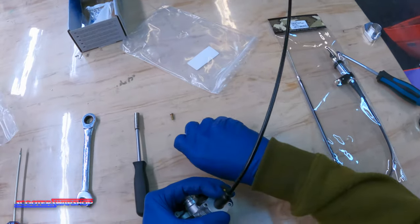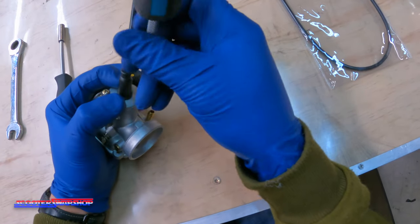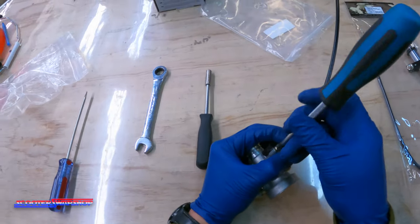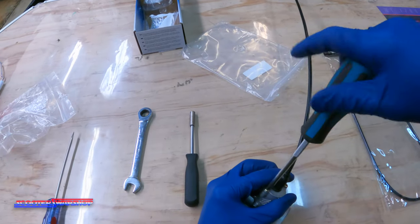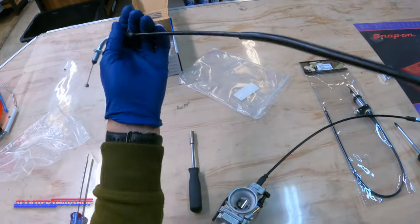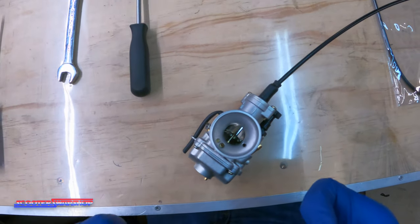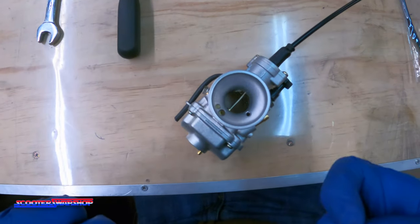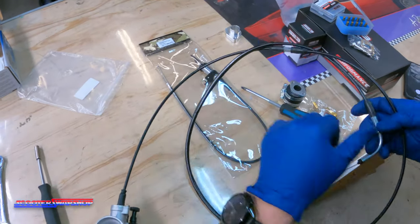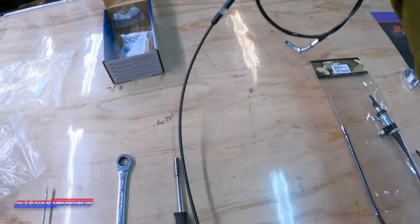Push this down. Now you can hold it with one hand, drop your two screws into position, screw them in. This carburetor install may seem a little daunting, but it is really, really easy. As you see, minimal tools here. You're going to spend more time taking the factory carburetor off and the factory airbox off than you are putting this together — this is very simple stuff. Now once you have it together, you want to pull on this cable just to verify that the slide opens all the way. Snaps down nice — you want to hear that snap down. If it doesn't go all the way up and doesn't come all the way down, you've got a problem in here. Take it back apart, review the video again, and repeat the process. Just double check as you go along.